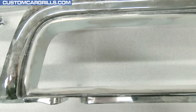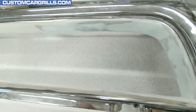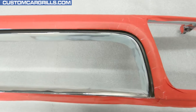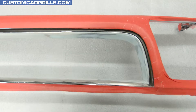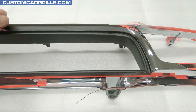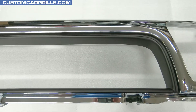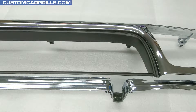When it's all finished, this is super smooth and the edges that were repaired are looking really good. For this install, I'm going to tape off the center section for paint. Of course, if we wanted to go all black on the whole grill, then I would have stripped the chrome off beforehand. I painted the center section flat black, waited for it to dry a little bit, and then removed all the tape. This reveals a whole different looking grill than what we started with — it's incredible how factory fresh this looks, and all the hard work that was put in is starting to pay off.